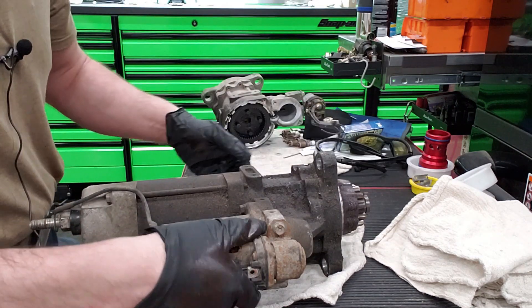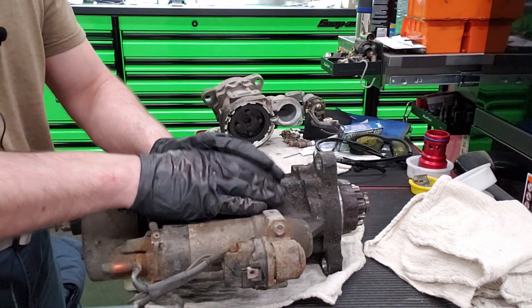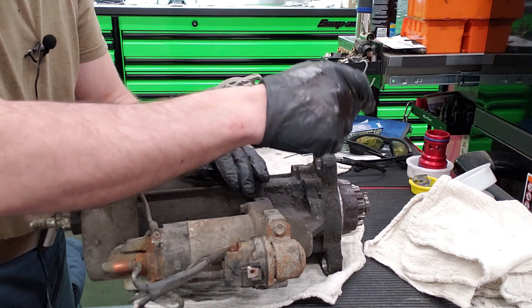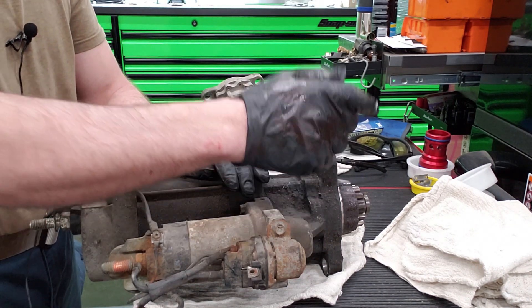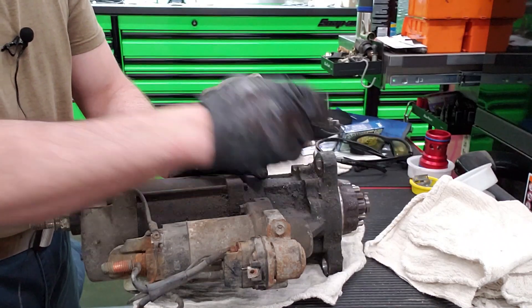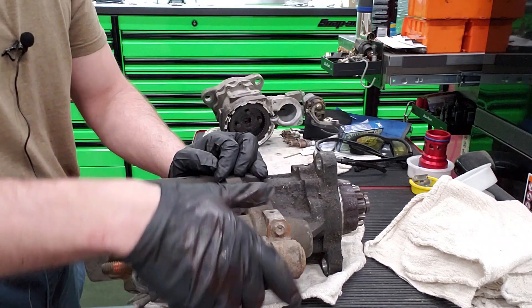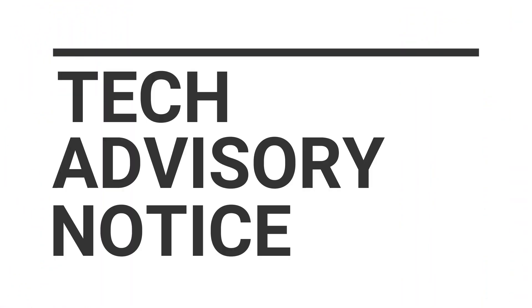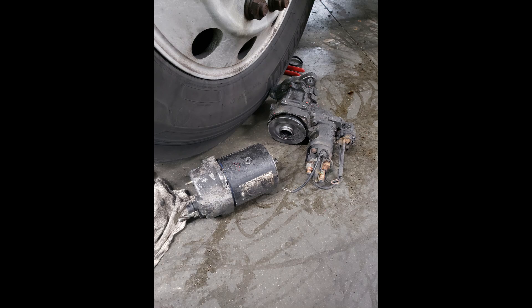Do enough of them though, you're usually all right. But this one came out how it was supposed to — didn't have to dismantle this one to get it out. On occasion there might be one with a real stubborn bolt or the bolt might've been cross-threaded from before, where yeah, I've got to dismantle all this so I can get my air gun right up on it, pull it out that way. And one quick thing to add: do not use red Loctite. Use blue or nothing at all. Do not use red — it sucks.